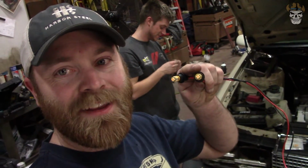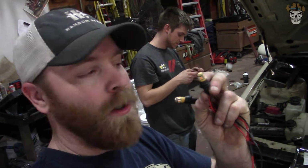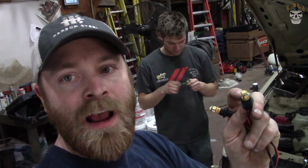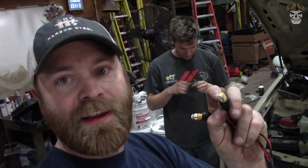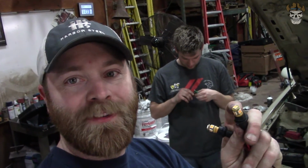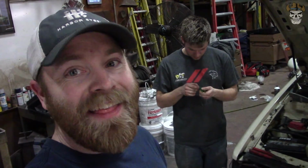Well, right next, that was interesting. What happened is, since these are rubber plug-ins for the bulb, the terminals are not held apart from each other. On a typical plastic one, the terminals inside are just molded into the plastic. Well, with this, the bulb holds the connections to the side away from each other, and when I didn't have one bulb in the other one, both the terminals inside were able to touch each other, and it melted my jumper. So that could have been really bad.